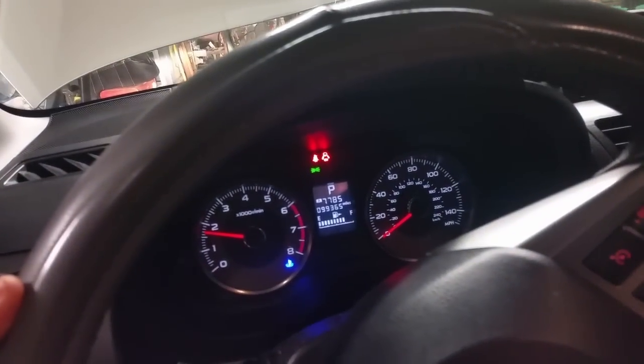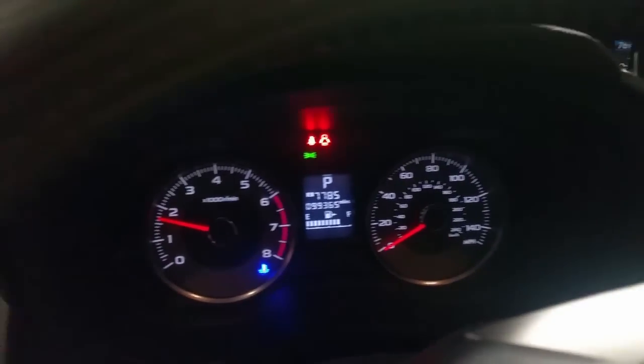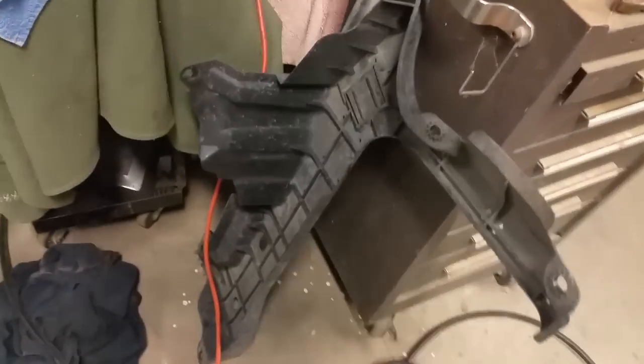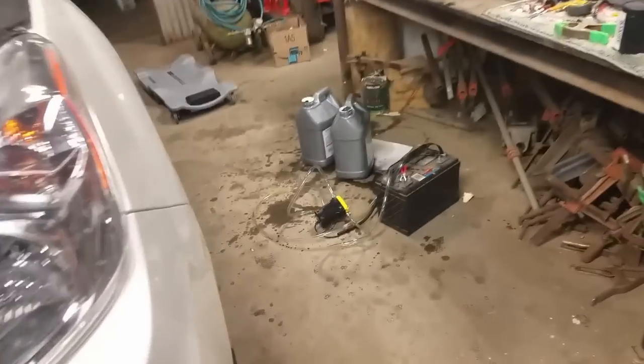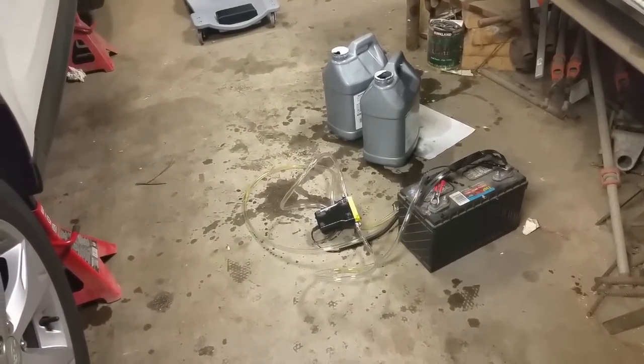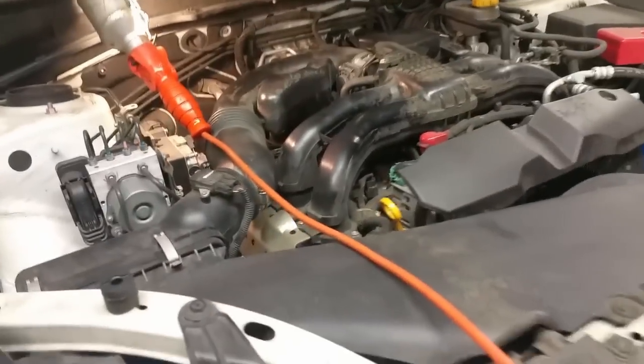The engine is on, no check engine lights or CVT lights — that's a good thing. I checked where we hooked in and it's looking fine. No fluid catching fire. The only things left are putting the undercover back on and cleaning up the mess. I used around 18 quarts total for this exchange, so I'm glad I got five gallons of CVT fluid. You could probably use less if your transmission isn't as dirty, but mine needed it.